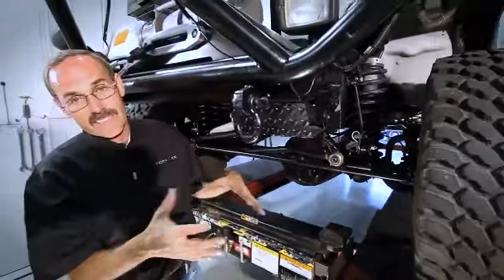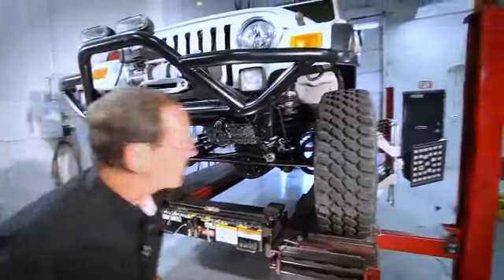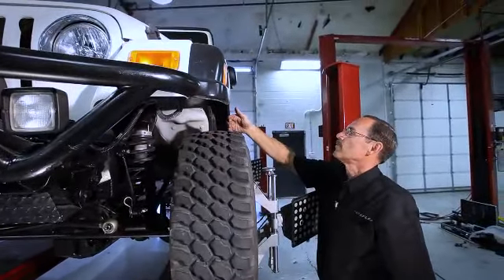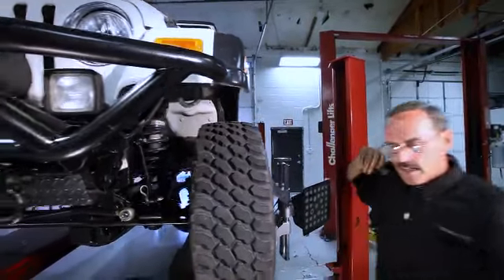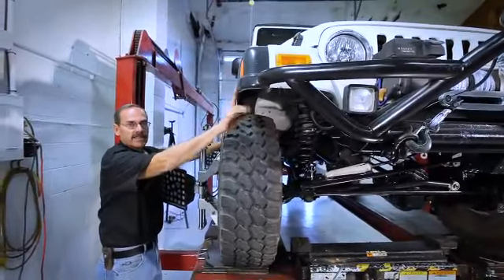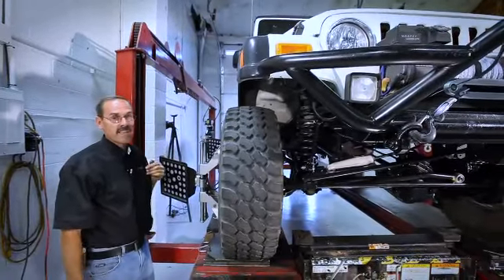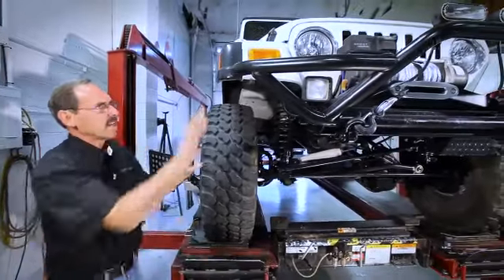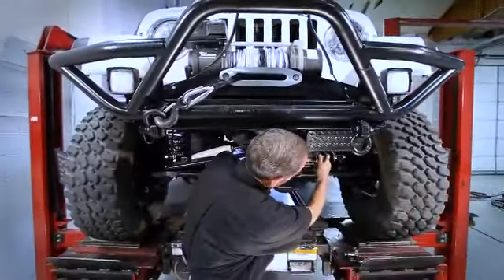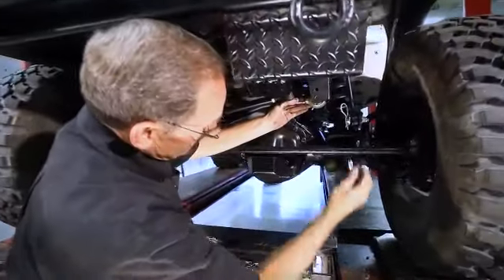Often times that will in and of itself line that axle up with the body. Let's just look down the sides like we do and see how this lines up for a quick reference. We look off of here, sight down — we're just right off of the notch on that tire tread. Let's look at the other side — same thing, line these up, we're looking good there. That looks like it's just right there. Now that we've got the body centered over the tires, all we need to do is make the adjustment by winding in the adjustable end and then sliding it up into position and dropping the bolt in.